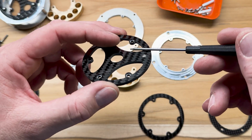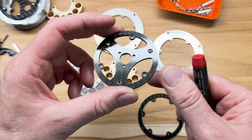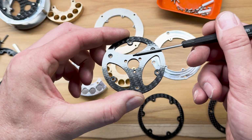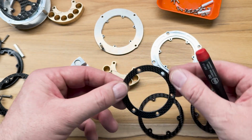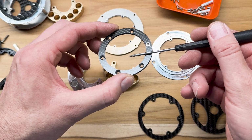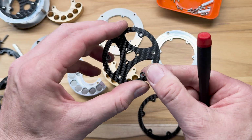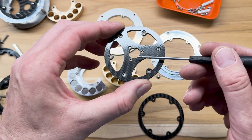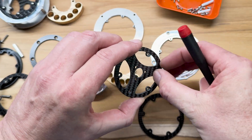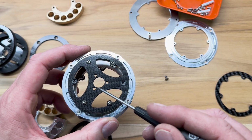So that beadlock bolt is not quite flush, but it's much more flush, and it has a nice round head. So this is not going to get hung up as much. On my design, I went full countersunk flush. So I think with this plate, as thick as it is, that's a great solution. This is a great approach to help sink that head in. Really nice work.